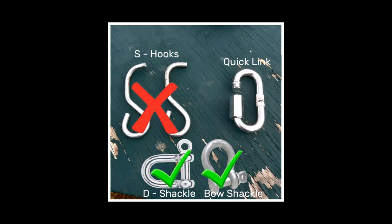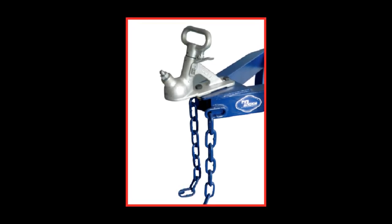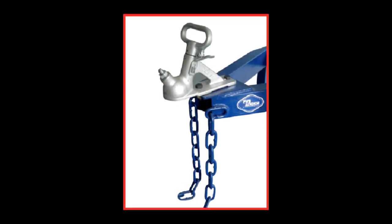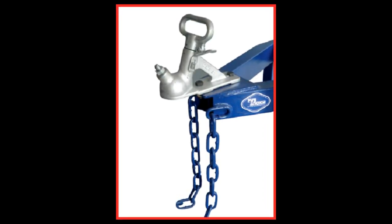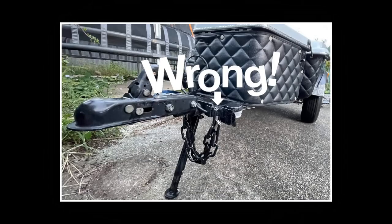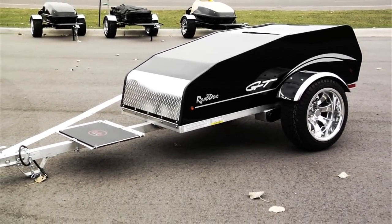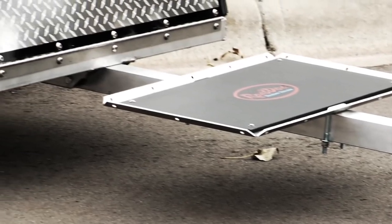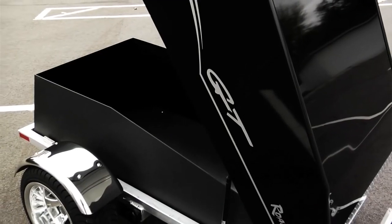If your chains are welded to your trailer chassis, at least 50% of the chain link should be welded on each side of the drawbar, not underneath, and in the horizontal position only. Alternatively, you can use brackets welded or bolted onto your trailer. Your chains also need to be as short as possible, but long enough so they don't pull tight when turning sharp, and never allow your safety chains to drag on the ground.